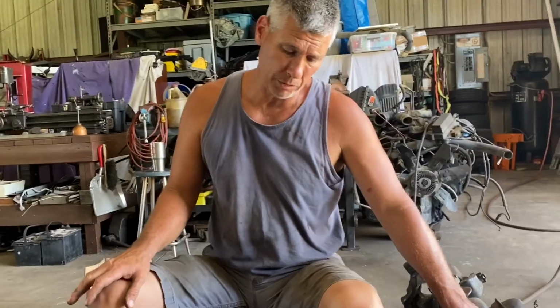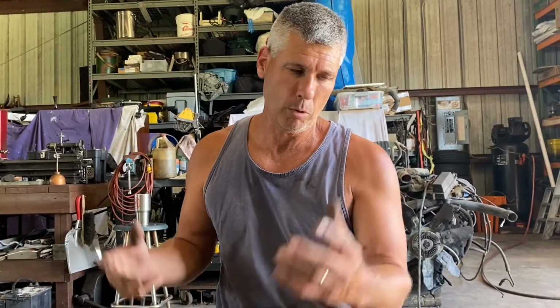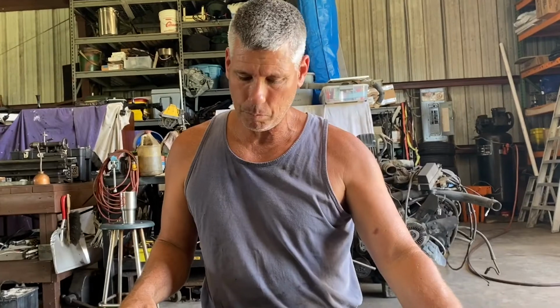This axle is going to end up with a Detroit locker and 456 gears. I've got some CTM joints for it, good 300M CTM joints, that I've been sitting on for, I don't know, 18 years. I don't have chromoly shafts going in it, so right now I'll just put the factory shafts and factory 260 joints in it until I can order shafts. It's not a big deal. But let me get this stuff cleaned up.